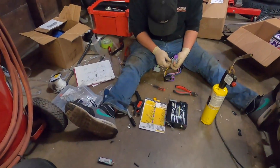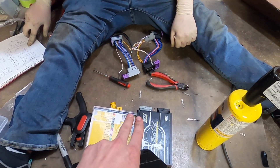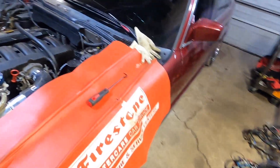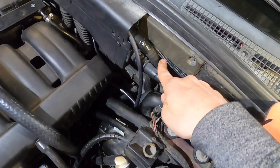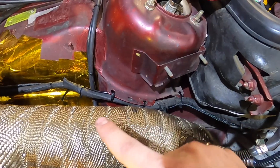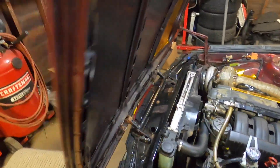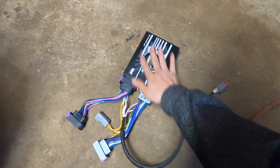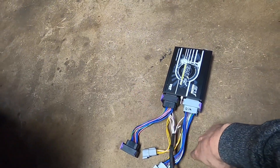Still out here grinding — pinning in the last couple of things from the harness with all the new sensors to go into the standalone. We have the IAT and fuel pressure sensor tucked all the way up, routed along the headlight harness to the boost solenoid, then into the E-box. That connects into what Zach is pinning out, which will plug into the ECU. Here's the standalone with the two plug-and-plays with the wideband pinned in, and the connector pinned for the IAT and other sensors. Now this all hooks up into the E-box.